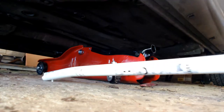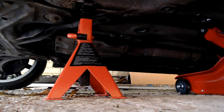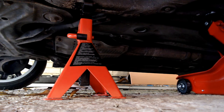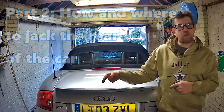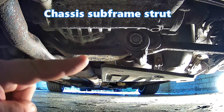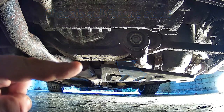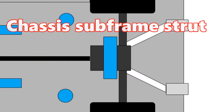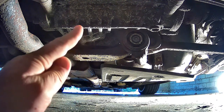If I'm only working on the front of the car, I tend to put the jack back into position in firm but gentle contact with the rail once more for added safety. With the front of the car jacked up, let's switch our attention to the rear. Looking from the rear of the vehicle we can see this bar here, which is part of the chassis. It's in line with the rear wheels and the axle, so we're going to take the jack, put it underneath this strut and lift the vehicle straight up.